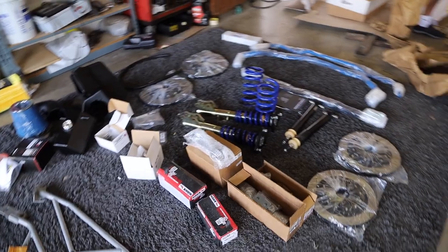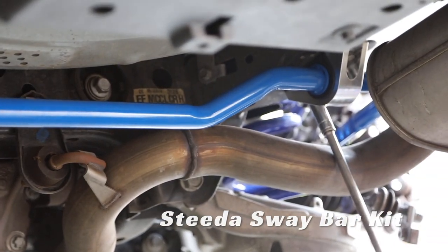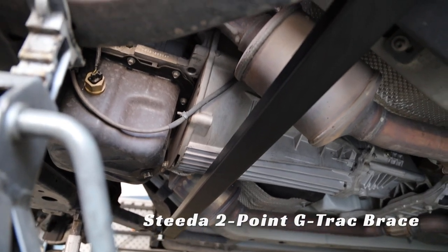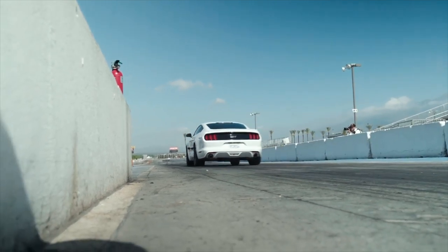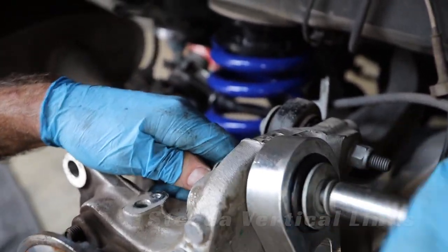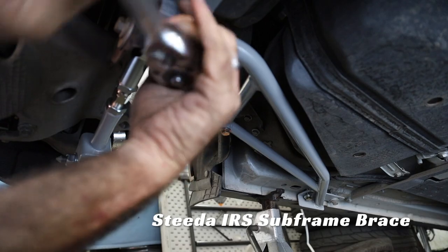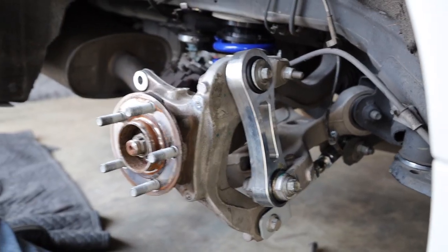We had the car apart for a couple of weeks and worked front to back, top to bottom. We installed the ST adjustable coilovers and paired them with Steeda adjustable sway bars front and rear. We also did Steeda's two-point G-Track underbrace up front. Out back, Steeda recommended their Stop the Hop package — high-horsepower rear-wheel-drive cars with independent suspension have a tendency to wheel-hop under hard acceleration and cornering. The package includes heavy-duty billet vertical links, adjustable toe links, underbraces that tie the subframe together, and a subframe support system that limits lateral and vertical movement. For the S550 Mustang, whether GT or EcoBoost, addressing the rear suspension is probably the best bang for the buck.